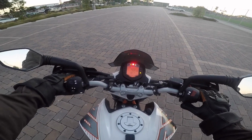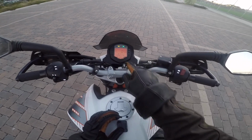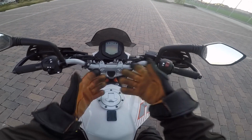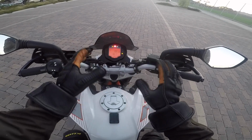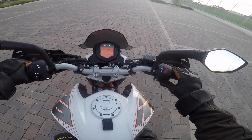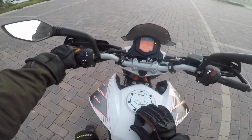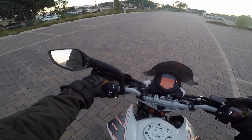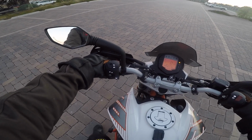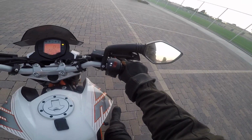So one more time. You want to start the bike up? Turn on the key. The bike's in neutral. The switch is on, because if not, you're not going to see anything. All 3 of those things are good. Once all 3 of those things are good, you pull in the clutch, start it up. Want to take off? I'm in 1st gear. Slowly, I start to move a little bit. Once I start to move a little bit, give a little bit of gas.